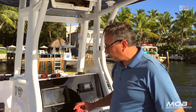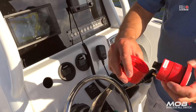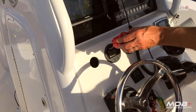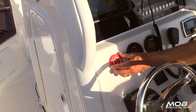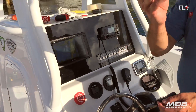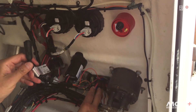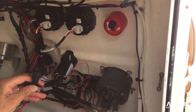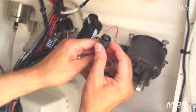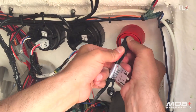We've drilled our hole in position and are ready to mount the x-hub. To mount it, unscrew the sleeve, make sure your o-ring gasket is in place, then slide it right in — make sure it's centered with the battery indicator on top — and go in the back to screw it on. Then we connect our harness to the x-hub: it's a five-pin waterproof connector with a notch that matches up, so you line it up, plug it in, and screw it tight.